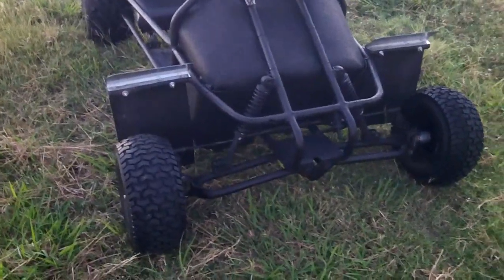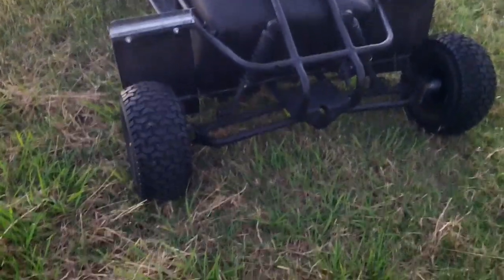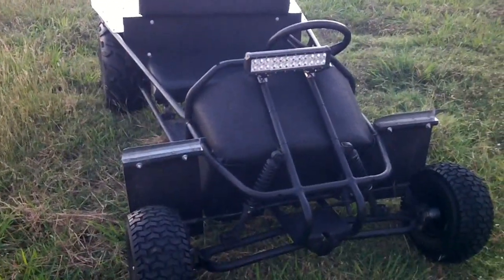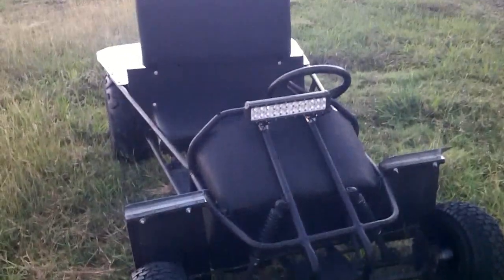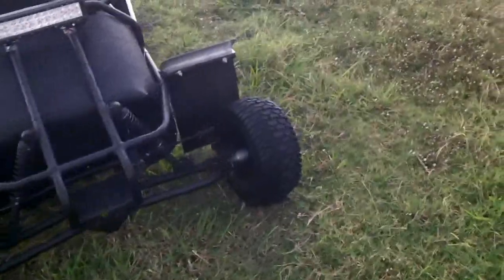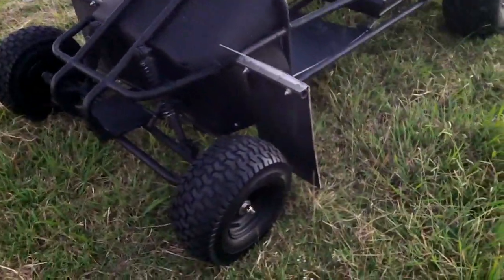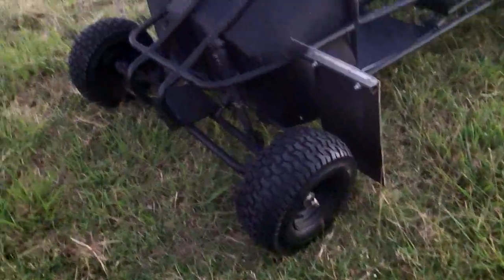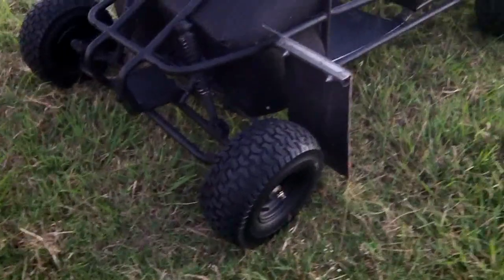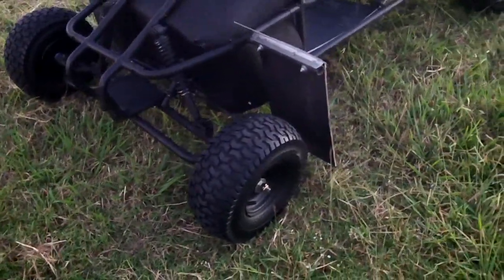You can tell they stand out a little bit more, but I actually like them. I took it for a test run earlier and it actually handles a lot better — I don't know if it's just the wider tire and more contact on the pavement, but it grips a lot better. I've adjusted the tie rods now with these, and I guess the combination of all those things makes it turn tighter. Definitely nice.